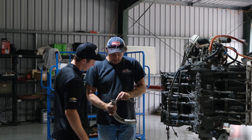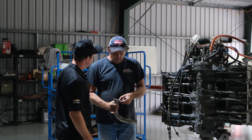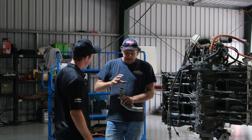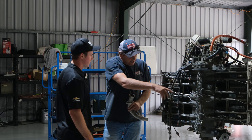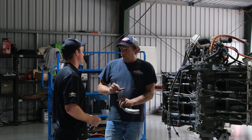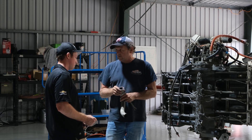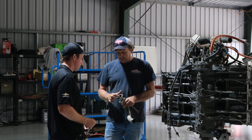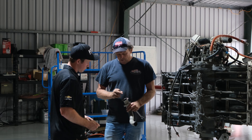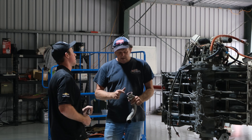See it's been leaking — it looks black there. What happens when that happens? It hasn't been sealing. Because it's an intake tube that sucks air, and it's already got a metered amount of fuel in there from the fuel servo unit through the spider. It already assumes there's no leaks, so it's got the correct amount of fuel — this cylinder could be lean, which you'll notice by the EGT on this cylinder. So that's something we're really fussy on. Once the engine's together, we've got a little test to make sure they're definitely sealed. When you first build the engine, that O-ring can be a little bit rolled off and leak — it only just seals by a couple of mil.